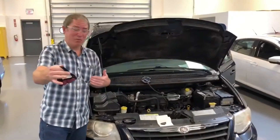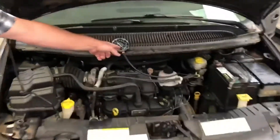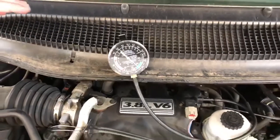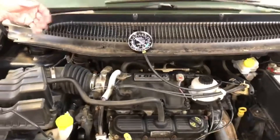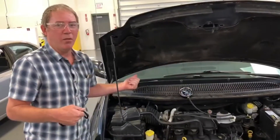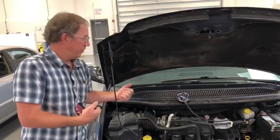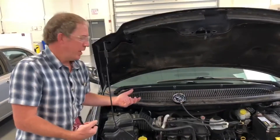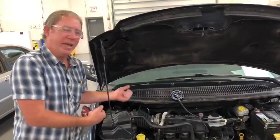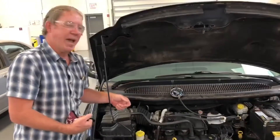This thing is starting to smell a little bad. You can see the vacuum gauge is wanting to dip down at idle — it's wanting to kick back. I'm thinking the exhaust is backing up between the manifold and the catalytic converter. When we open the throttle to 2,500–3,500 RPM, we dropped engine vacuum all the way down to nothing because we couldn't get the exhaust out and didn't have anywhere to put new air. It just stacked up in the engine and intake — higher-than-normal pressure in the intake manifold. We can't get air out, so we can't get new air in. We're going to do diagnostics to confirm the catalytic converter is stopped up.